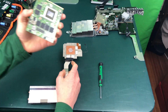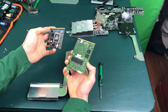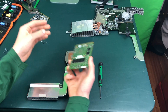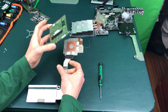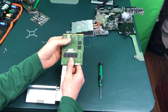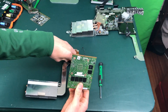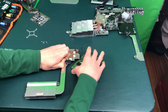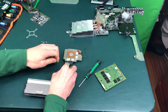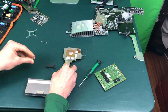As you can see, my graphics card is quite a bit longer — it is a different length. There will be a few things on the actual iMac we will have to adjust, but we will be able to make it work and it will be totally worth the upgrade because the performance will be so much better. You may have to tear this foam piece here — unfortunately there will be a few things we may have to tear or break in order to get this GPU in the iMac.